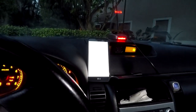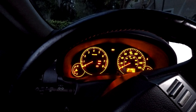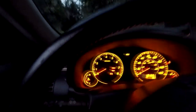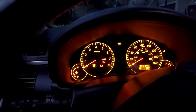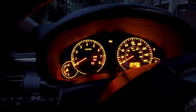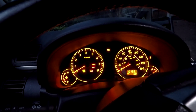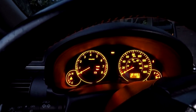I'm going to go ahead and run through it now. I pressed it five times, I'm going to wait seven seconds, fully depress the pedal. Let it go at 10 seconds when you see the service engine light blinking, then wait 10 seconds, press it again after the 10 seconds, keep it for another 10 seconds. Go ahead and let it go, turn your car off, then start the car — the ECU has now been reset.